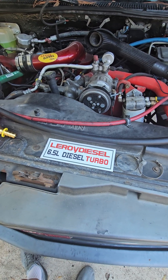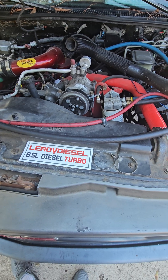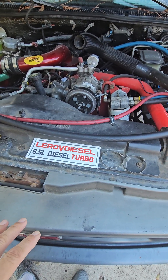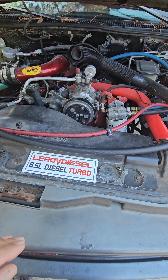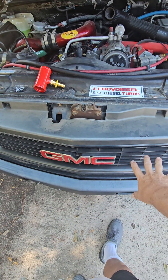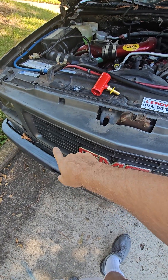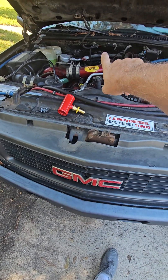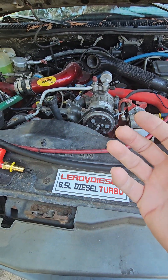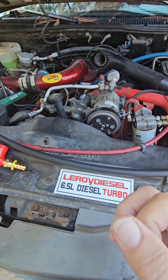The cooling on these things is lacking, so we're trying to do everything we can. Keep your radiator clean. On this particular truck I've actually relocated the oil cooler to get it out of the heating stack, and I relocated the transmission cooler up underneath the bed of the truck. The transmission cooler is well protected, but that's not a kit I'm interested in producing.